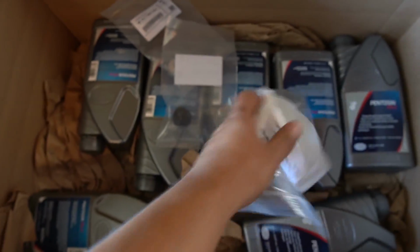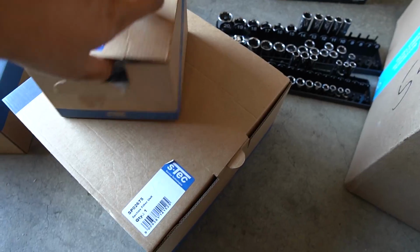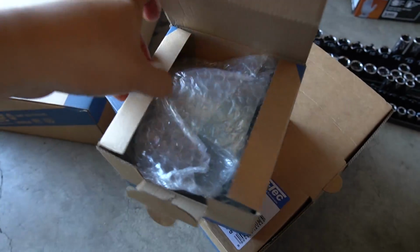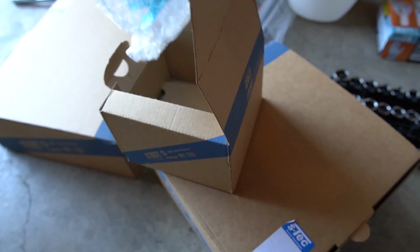Another option is that you can drain and replace the fluid without changing the filters. In this case, you'd only need 5 quarts of oil instead of 7, and you wouldn't need to use ISTA, but the downside is you'd be mixing new oil with old oil, which is something I also don't want to do.